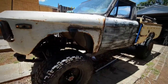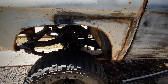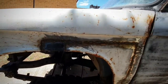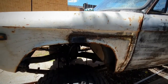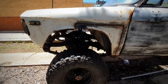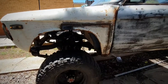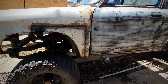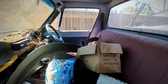The 106 chassis is missing some bits — no driveline, no shocks, barely any suspension — but that's all right, we can work on that as we go. So far I've mounted the body, I've had to chop and section the guards, opening up the gap by about 100 millimeters. I've also pushed the diff forward a little bit to help with that. It will be getting a rear-to-front leaf spring conversion at some point — I do have the leaf spring sitting around for when I have time.